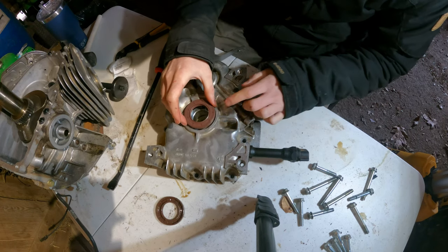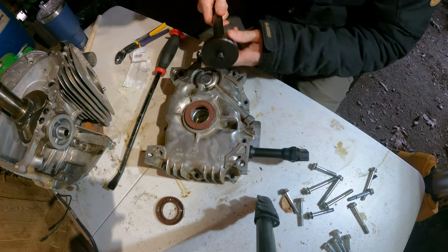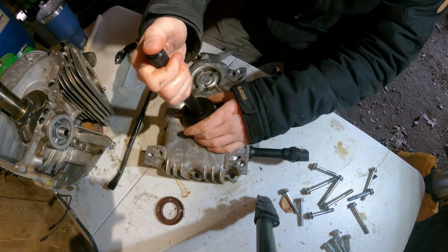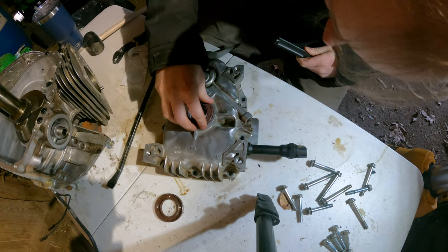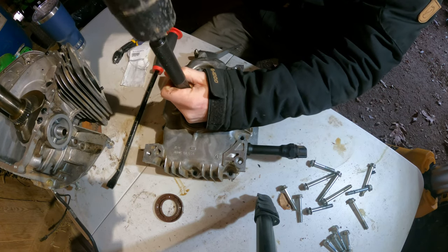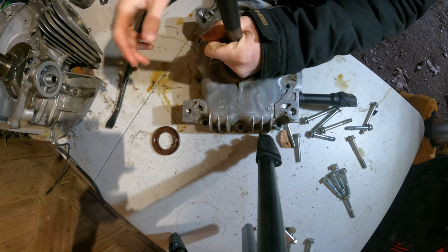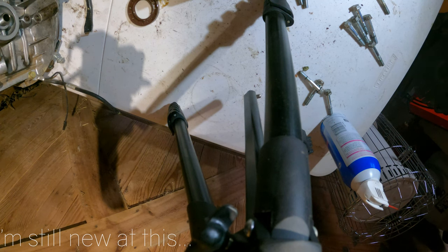The biggest thing when you're putting these seals in is you don't want it to go in crooked. So I'm going to set that in there as flat as I can. I've got a 63 millimeter seal driver — I may need to go smaller, but I want to go as large as I can. I'm going to set that on there and make sure it's going in straight, not canted to either side. I'll give it a couple of light taps, checking that we're going in straight — and we are. It's going in nice and even.